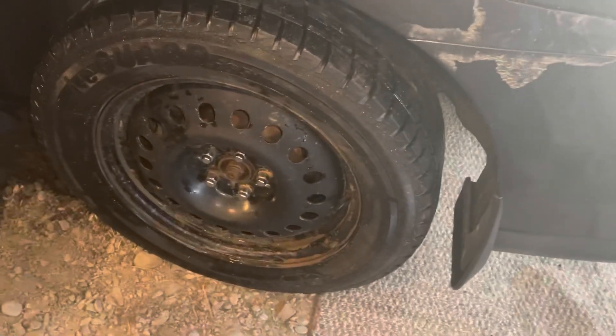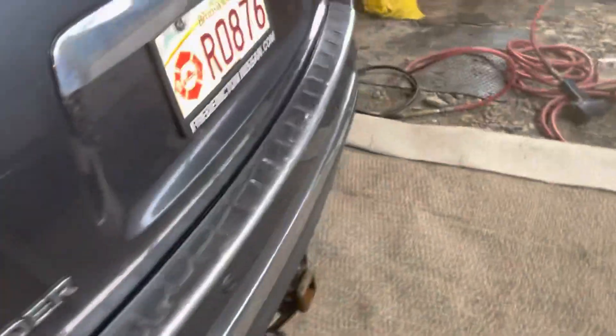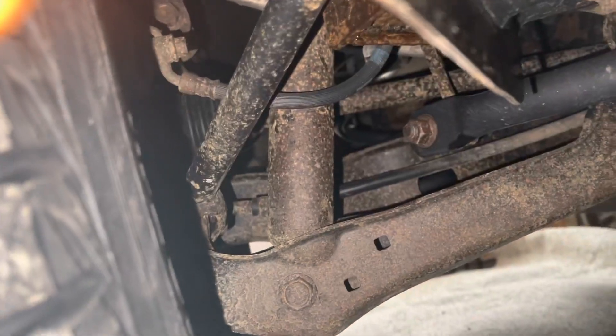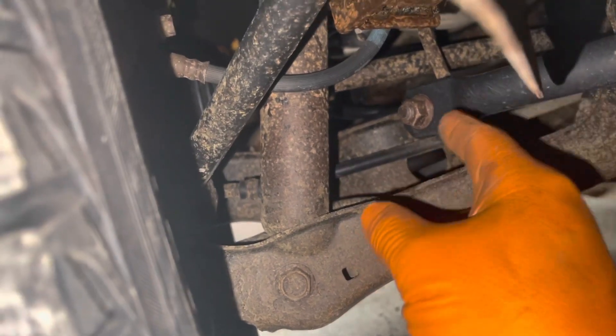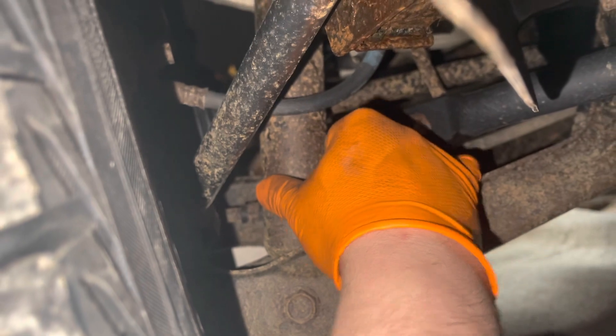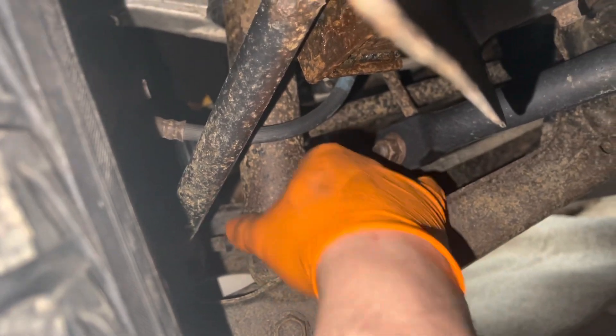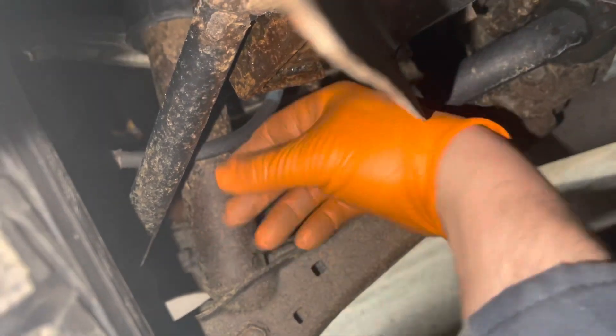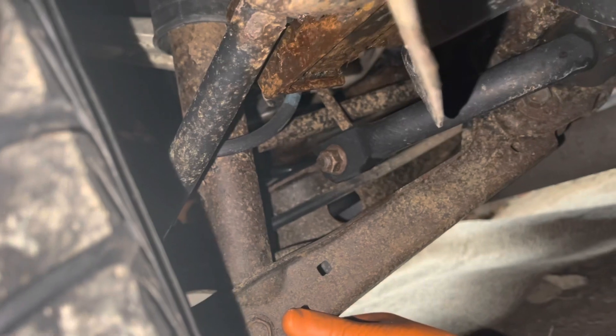Okay, we're all buttoned up. We did one side. It's Friday night and I'm tired, so I didn't show you much of how it was done because I'm forgetful and task oriented. We'll do this other side tomorrow morning. This is actually the side that has the problem — I'm going to show you what prompted this repair. We had a noise, it got real bad this week. This is the shock on the passenger side. The bushing is gone — see how that moves? That is the noise that we're hearing. So I figured if we're doing that, it's a 2013, it's pretty tired, we might as well do the springs and shocks on both sides.